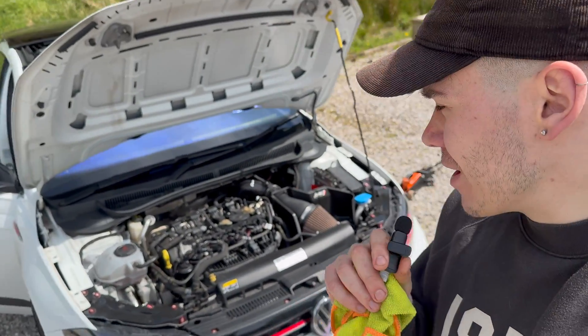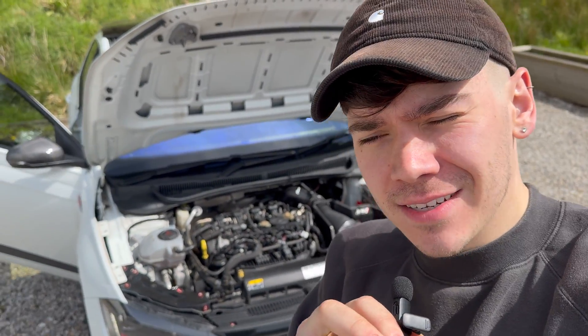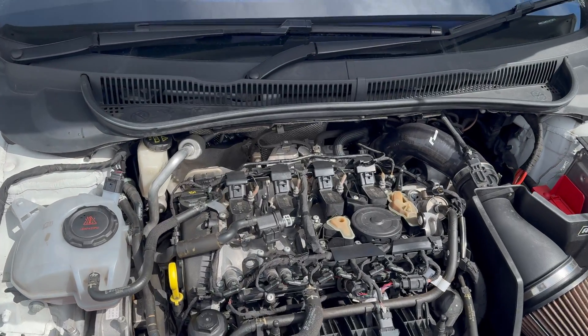Right, so the engine is now running. I'm letting it get up to operating temp, then I'm going to shut it off, let it sit for about five minutes, check the dipstick, top up if needed, and if not I'm all good to go. It even sounds healthier.